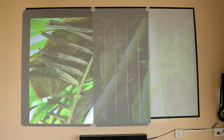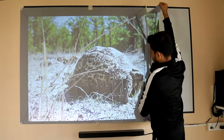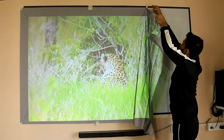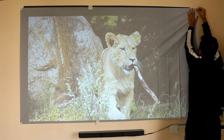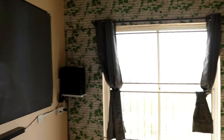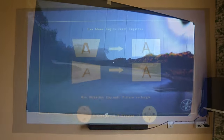The thought crossed my mind about why I put so much effort in painting the wall. Now here is the tricky part: the screen specification mentions that viewing angle is maximum 30 degrees — this applies horizontally as well as vertically. To get optimal results your projector needs to be in line with or near your eyes. If I place the projector away from the screen and project at an angle, sitting in front of the screen I don't see video at all, but moving towards the projector the quality becomes much better.